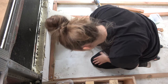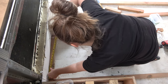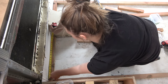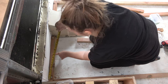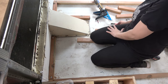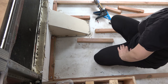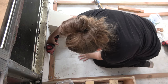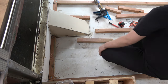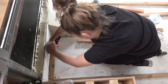And you can see I'm applying pressure, but I'm not putting it all the way through because I will be taking those out. And I believe, yeah, it looks like I did one in the middle as well. So I was just trying to kind of go halfway through the middle, put another self-tapping screw. That way it was at least in line with what I needed. But I will take those self-tapping screws out here in just a moment. And then I'll put some silicone in those holes and put it on those self-tapping screws, and then I'll make sure they're nice and secure.